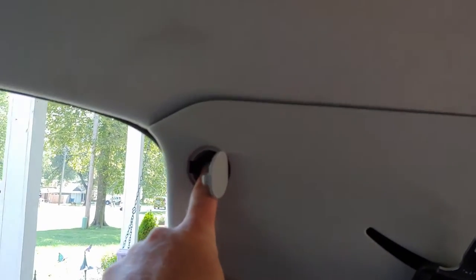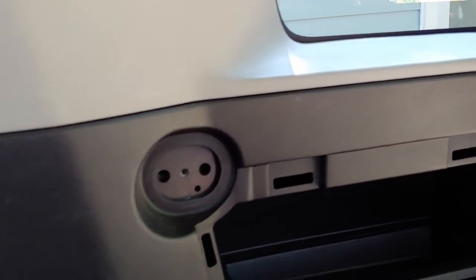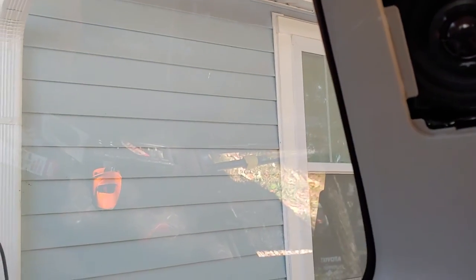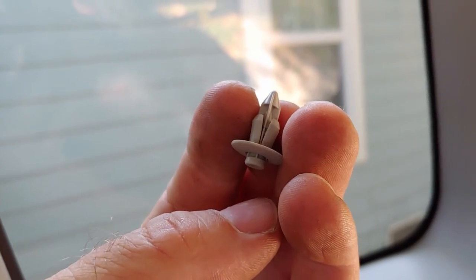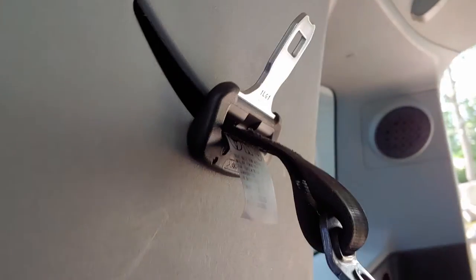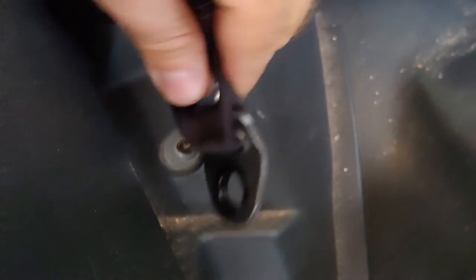You should hear all those satisfying pops. Then we reconnect everything we took out, starting with this one up here. Put these little guys back in with the little hook anchors. Get this one back in like I showed you — it should look like that when you put it back in, and then flush after you're done. With the panel all back in and in place, grab the new seatbelt and run it down and bolt it — keeping it flat and bolt it right there. You want that side facing down.